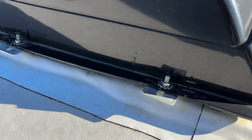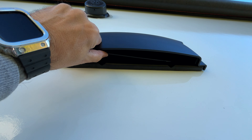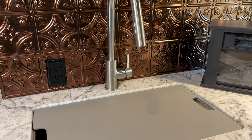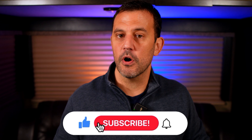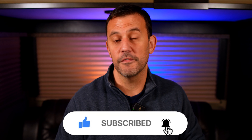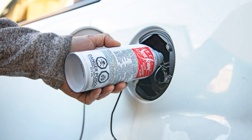Number ten. Close all of your windows and draw all of your shades — this will keep UV light off the furniture and the interior of the RV. Now regarding airflow inside the RV, I know some people crack their roof vents, and I think this is perfectly fine if you have vent covers. However, vent covers do not completely seal your roof vents, so under the right conditions water, snow, and ice can get underneath, so I always leave mine closed. What I will do is leave my stove top vent open — that's a much more difficult way for water to get in, and it still leaves a little bit of ventilation inside the RV. I've also had a lot of people ask if they should leave their sink or shower valves open during the winter. Personally, I have never left them open, and after eight years of Pennsylvania winters, my plumbing is fine.